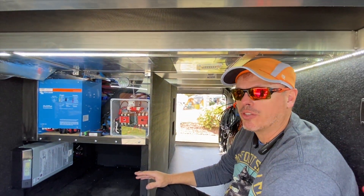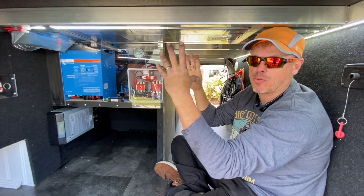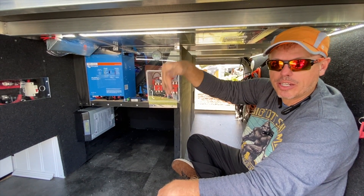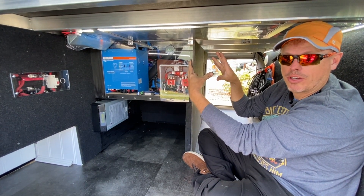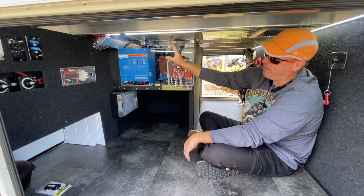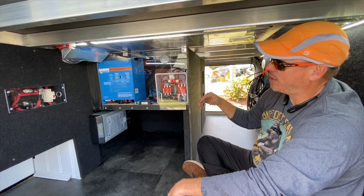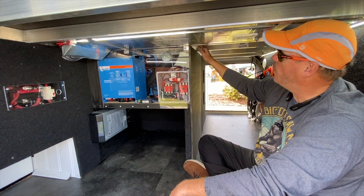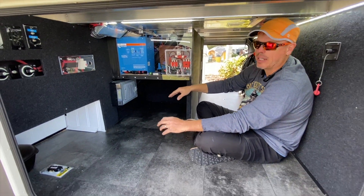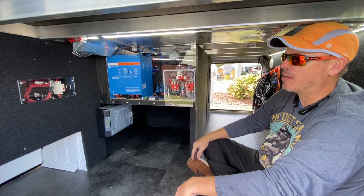The roof access on this one was a little different. When you walk up the steps, at the top you turn right and go up the next set of steps, and there's a cabinet there — when you open that cabinet, that's where the electrical panel is. The roof access, when you take the plate on the roof off, leads to a chase that goes down behind the breaker panel for the RV, then turns 90 degrees and goes further back, coming down on the basement wall. You can't really see it because of all the plumbing and wiring, but nonetheless it was not that difficult to fish. All said and done, we ended up with all of this floor space for storage containers, and he kept all of his original basement modification storage space.